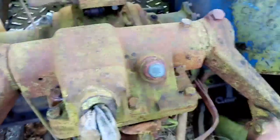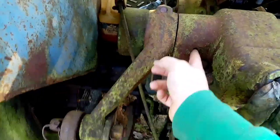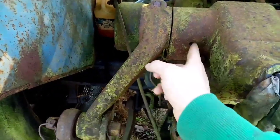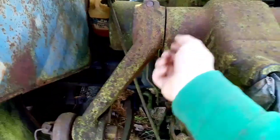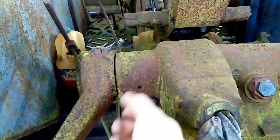You can take it off and put it backwards. I'd rather just have a box of brand new grease nipples with me. You'll have to clean out the threads with a small wire brush — just clean it out in there. There are threads there, then you just screw in the new grease nipple, grease it up, and the job's good.